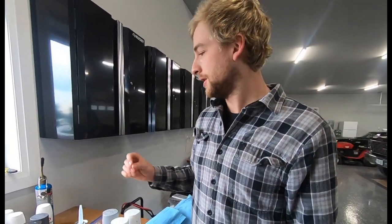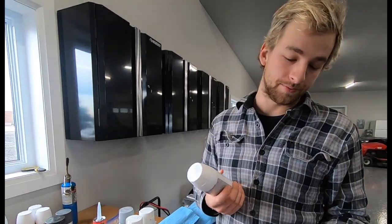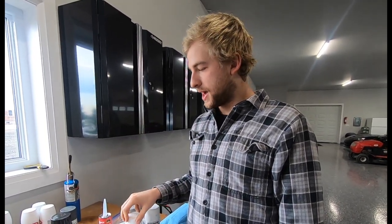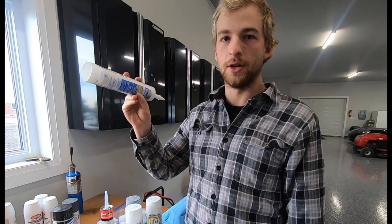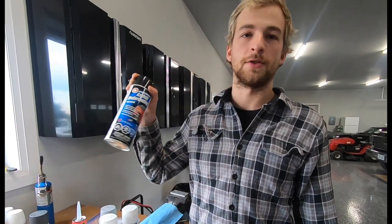We have a bunch of leftover paint found in the garage. We're gonna be working on that. And then all the seams, we are going to spray with this leak seal that we also found in the garage. And then around the welds, because we just spot welded it all, we are going to use caulking. Also in the holes that we put in the van, we're gonna caulk them, and then when we put the sound deadener over there, that should seal it. And then I'll get underneath and spray some of this asphalt undercoating to seal it from that side.